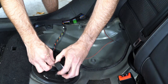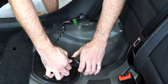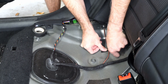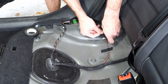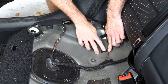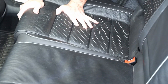I'm going to use a little bit of wire loom tape just to run the brown ground wire alongside the other harness wires and clean that up a bit. I'm also going to tape a couple of places down to the ground wire — that's going to hold the entire wire loom in place exactly where I want it and make sure it's not rubbing on anything. After that, we can put the rear seat back in. It's pretty easy to get back in and should lock back into place.